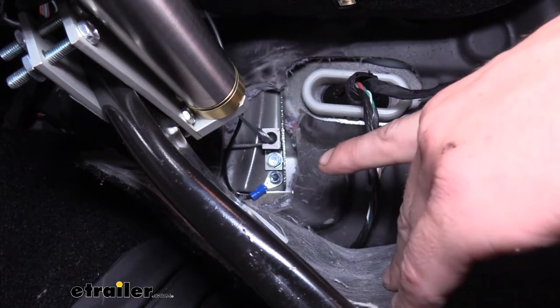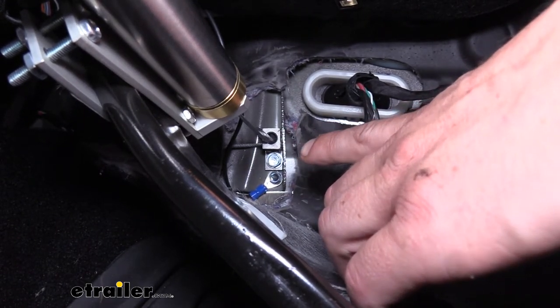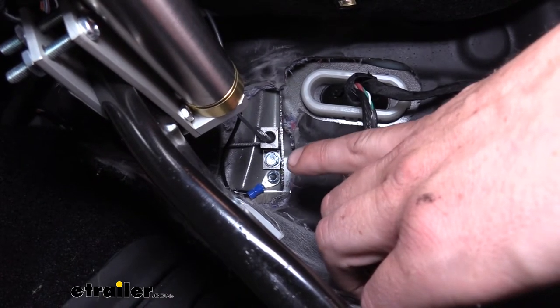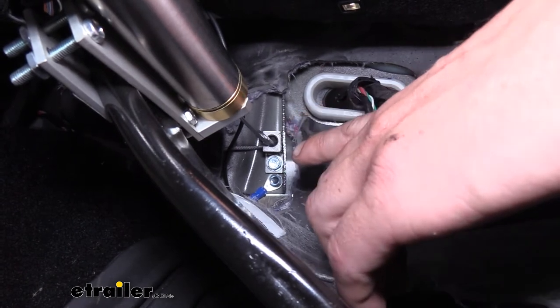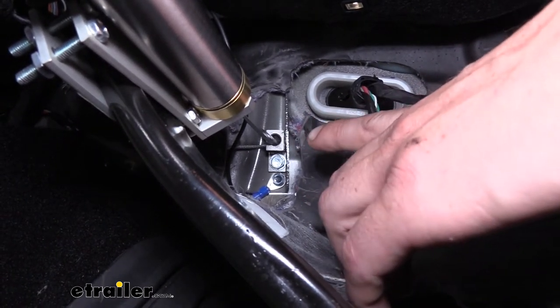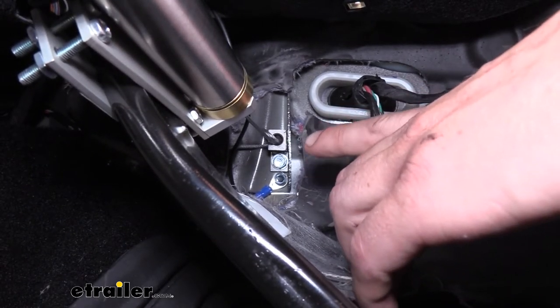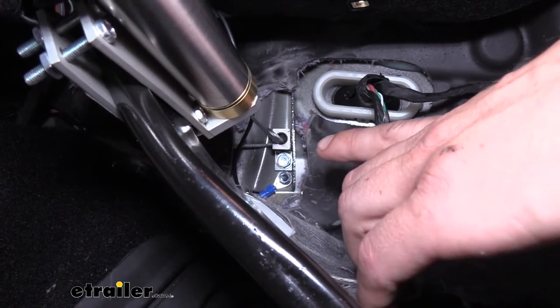On the back of our cylinder we have a cable coming out the back with an anchor point on it. The anchor point just attaches to the firewall using the included self-tapping screw. Once you've got that mounted, pull the slack out of your cable and then use a 5/32-inch allen key to tighten the set screw located on top of your anchor. I recommend tightening it down until it's about flush with the top of the anchor — over-tightening could damage the cable, and flush is pretty well the right amount of tightness.